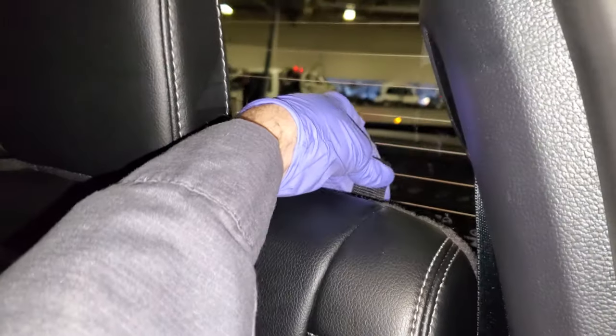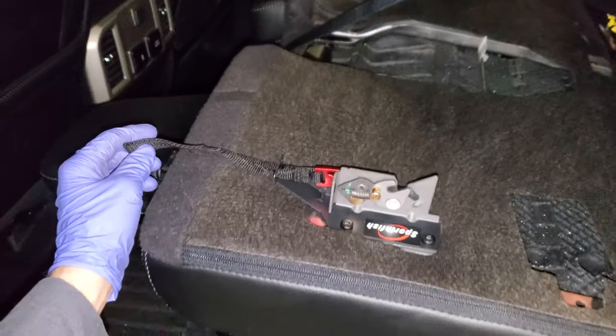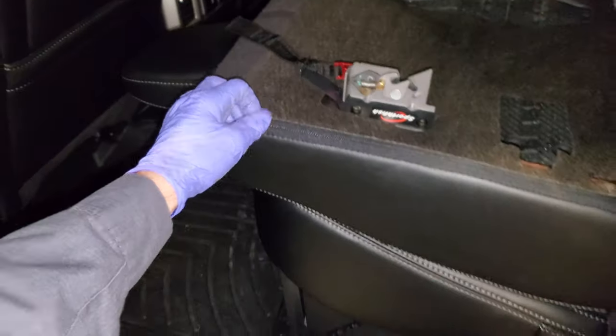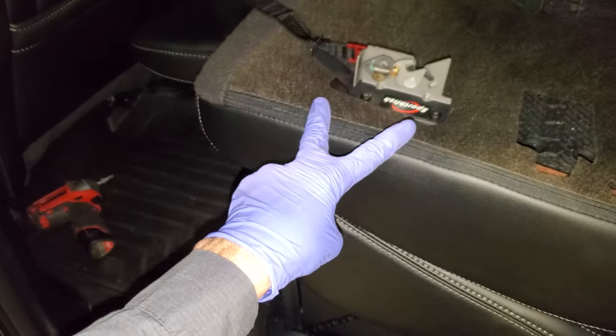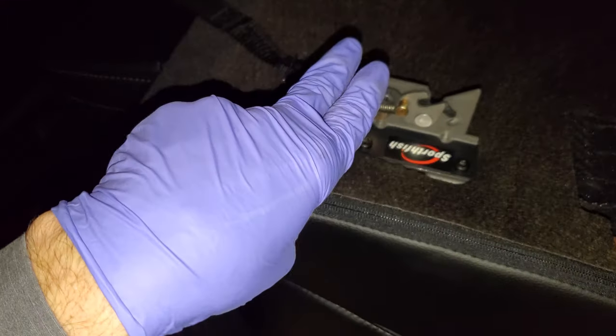Something real quick and easy — the tether is right here. You've got to pull this first and then pull the seat's tether. And that, my friends, is how you fold down your rear seat on the driver's side in the back of your F-250, 350, or 450 pickups — and the little baby F-150. Tell me what you think in the comment section below. Remember to like, comment, subscribe, share, and I'll see you next Friday.